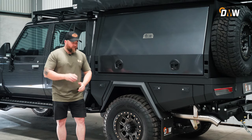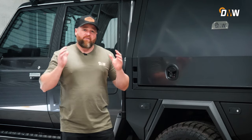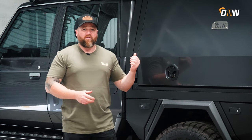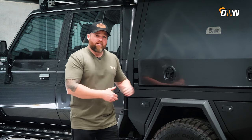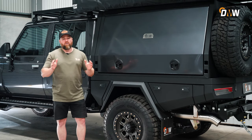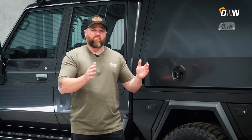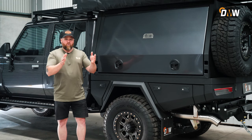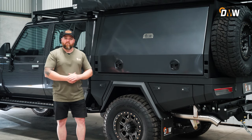The GVM is the biggest thing. As I've chatted about in other videos, the wheel track correction — if you get a four and a half ton GVM with us, whether it's the standard length 79 or the 300 chassis extended, we do the diff correction because that actually saves a whole lot of other issues. They track down the road, especially on some older bitumen roads that have been worn right in. You really notice the back end when they haven't been track corrected — they sort of walk up and down that ridge in the road, and this just prevents all that.